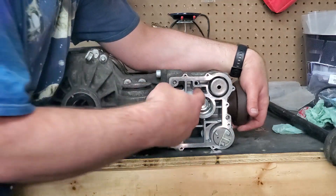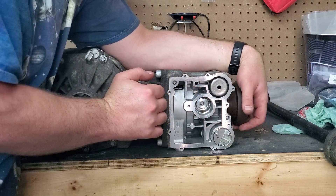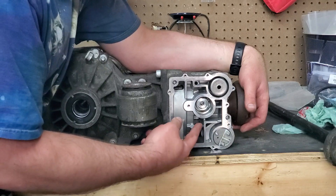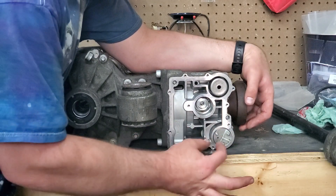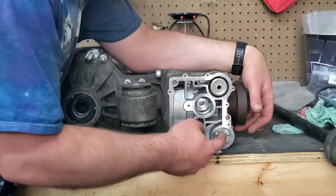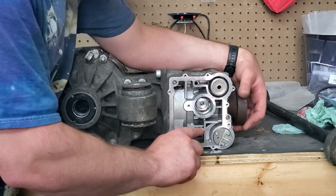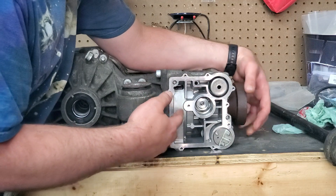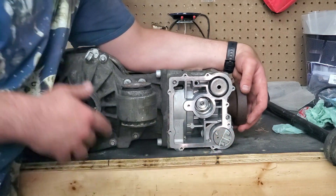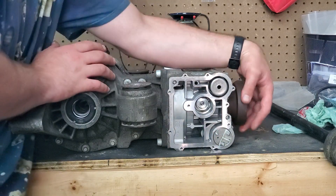The slinger is what brings the fluid back into the reservoir to keep the pump submerged in fluid and keep the system pressurized. Now if you're driving around and your all-wheel drive system is working intermittently, that's probably because the fluid is low. What's happening is it's pressurizing the system with what fluid it has, then it runs out of fluid in this chamber — it engages the clutches, and then since it's low it's not getting above the threshold, so you're going to lose activation of the rear wheels until it's able to get fluid to the pump again. If you have intermittent AWD operation, check the level.